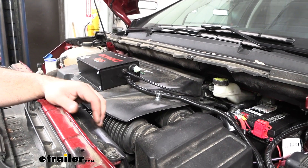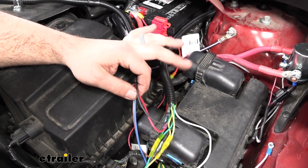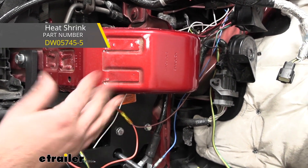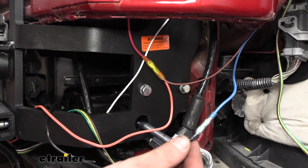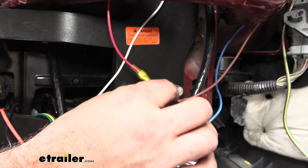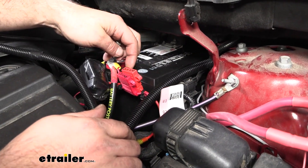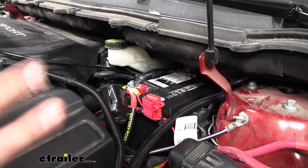Starting with the main unit, you have four wires coming off of it: blue, brown, red, and black. The blue and brown feed towards the breakaway switch — the breakaway switch wires are orange and black. I ran my black to the blue wire, using heat shrink butt connectors on any connections in the engine bay or anywhere it could get wet. Once you heat these down, they create a watertight seal — highly recommend them for a solid connection that won't loosen over time. The orange wire off the breakaway switch ties into the brown wire, then both attach to a red wire run to a fuse holder with a 20 amp fuse, then to the terminal — that's how you get 12-volt power. Don't put your fuse in until everything is hooked up.